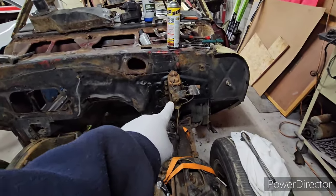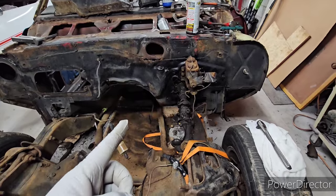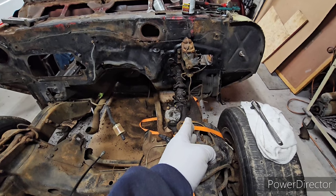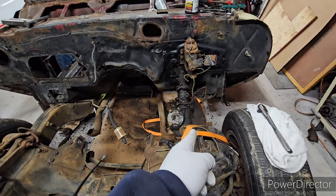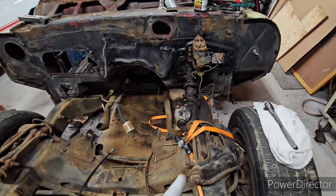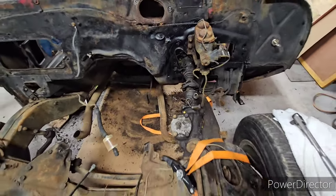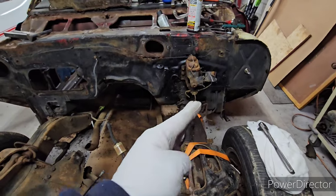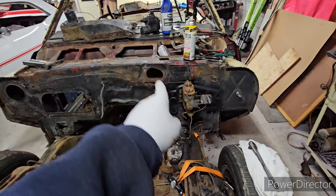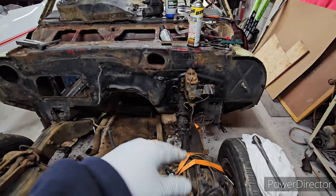When I removed the master cylinder - and I knew when I pushed this car into my garage - I knew there was a problem with the steering shaft and the power steering box here. The steering shaft was offset a little, because the way it wasn't flush on the rag joint. She was so much away and crooked, like an offset. And when I turned the steering wheel from lock to lock, I would get a jump on the car - a real bad, nasty jump.